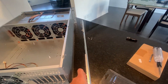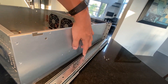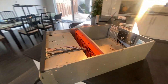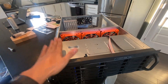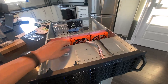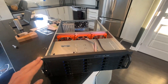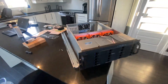For this we have to figure out how we're going to mount the rails. There are prefab screw holes so I'm hoping this rail kit will line up with those and we can just toss it in the rack. We've got a new fun project and I have a ton of really cool hardware to pump into here. First things first - we've got to get the rack prepared and the server prepared, because that's one of the most tedious parts of building the servers. Tonight I'm going to be removing the power supply from my Chia server and replacing it with a 600 watt, as well as putting the 750 watt into this one. I'm excited for this project - let's go.